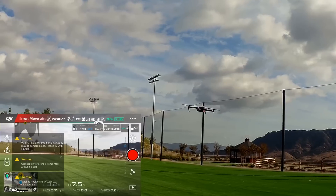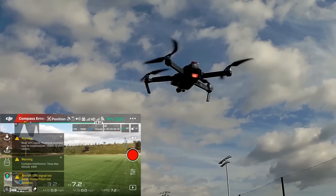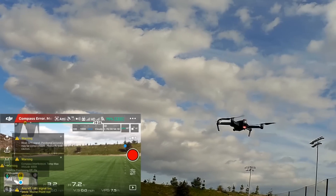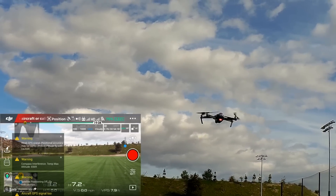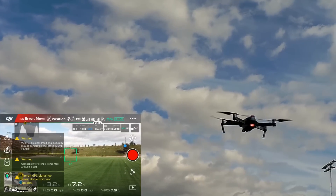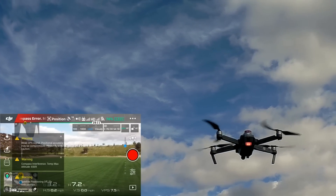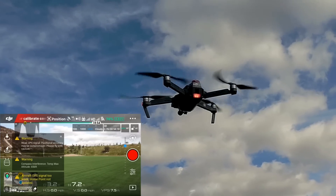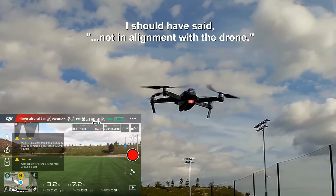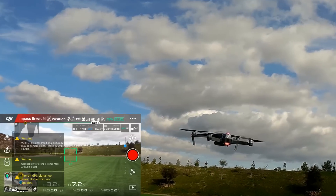When I let go of the stick it did that jerk motion, and it is yawing to the left. The camera is actually swinging right and left, and now it's just decided to move away from me — all these movements are on its own, I'm not controlling the sticks at all. Getting a close-up of the camera, it's actually pointing to the left, about 45 degrees, not in alignment with the drone. It's going left and right, so there's definitely some kind of association between the compass and the gimbal.